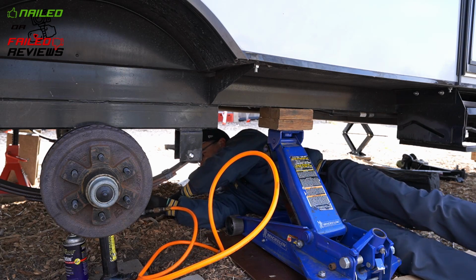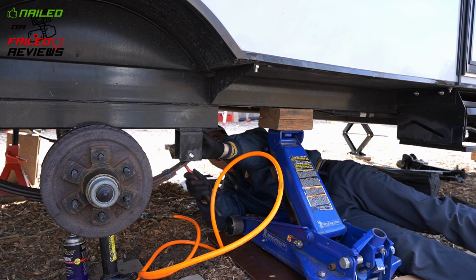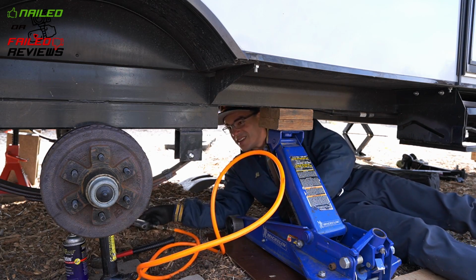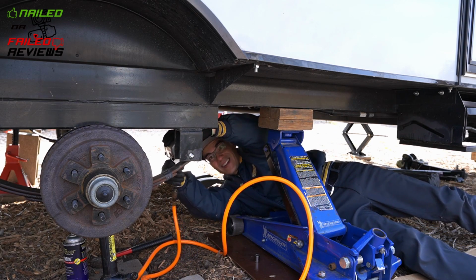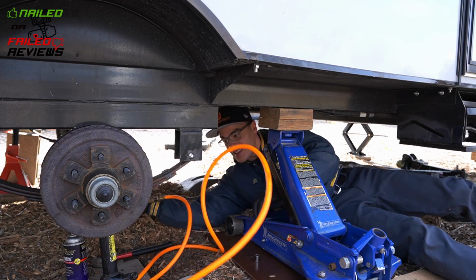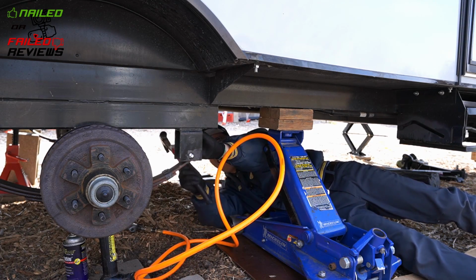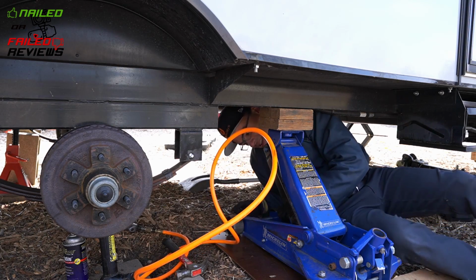Now again, because I was putting this bolt in on the inside of the trailer frame, where I had to create new notches or new keyways for the notches to go through, I actually decided to put the air gun on it and do a couple zips so that I could use the knurls on the bolt to give me a little bit more room. I was hoping it would knock some material off instead of using a reamer or anything like that.